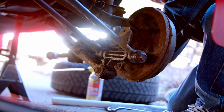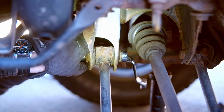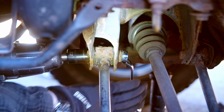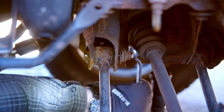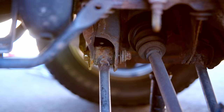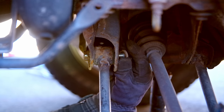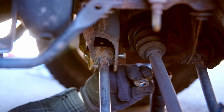Now we can start tapping out our knuckle bolt. However, you will have some binding issues with the rear arm, so it's easiest to get that rear arm out of the subframe first. Use a 22 millimeter socket on the bolt and a 17 millimeter wrench on the back — you have a nut and two washers. One of those washers is a cam washer, and that needs to come off as well. It goes into the subframe to help with the alignment of that bolt, because this is an alignment bolt.